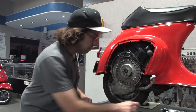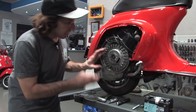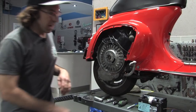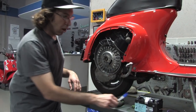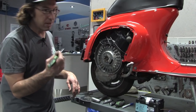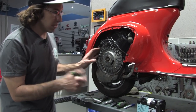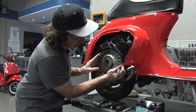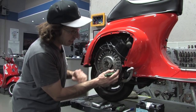Flashlight to look into the points hole. Flat screwdriver to make adjustments to the points — it's got a small flat screw in there. To make the marks, a fine tip Sharpie, or even better yet, you can use a scribe. You can use a carbide scribe to actually scribe the mark in the flywheel and also on a reference point on the engine case.